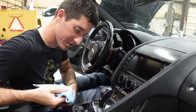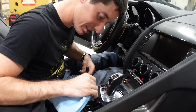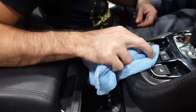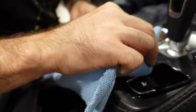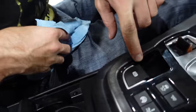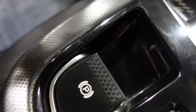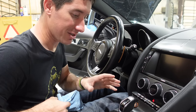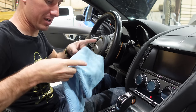I'm going to keep right on working with the alcohol — just a couple more swipes to get that last corner and the top. And that is the end of a button. So far the alcohol seems to be well and above in the lead compared to our other solutions. I'm going to try it on the other four buttons in the center console real quick, see how that comes out. If this works, we'll jump back over to our lower console and try to clean up those switches and get the oily WD-40 residue off. Just doing about 30 seconds of swiping on the switches — buttons we can touch after just a few seconds. Alcohol is far in the lead at this point.